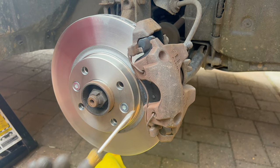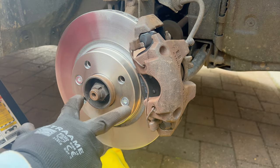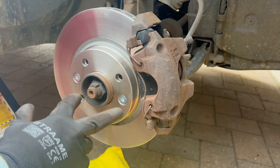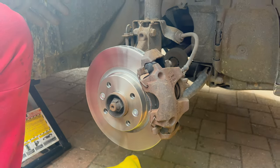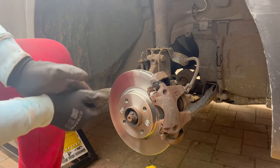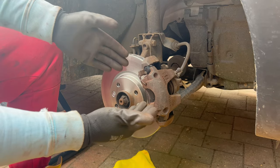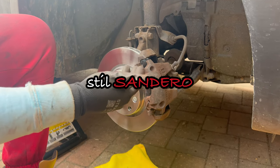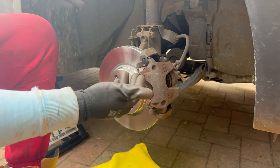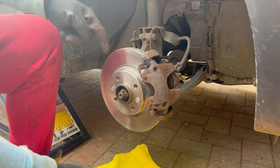Now it's all back in its place. Don't forget to tighten the two retainer screws on the brake disc, then put back the wheel and you're done. I'm gonna do the other side off-camera, but basically that's it — that's how you replace your front brake pads and rotors on this Dacia Duster or StepWay. I'm not sure which model it is, but I'll put it in the description and in the title of the video.